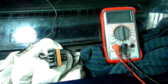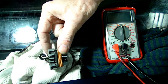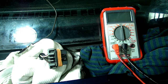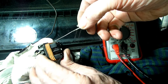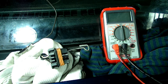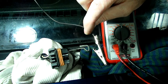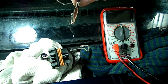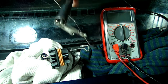After we remove the connector, the first thing we're going to do is see if we are getting voltage here. If you look closely at this yellow wire right here, that is the wire that feeds voltage up to the motor. So first thing we're going to do is set up our multimeter and get a little probe to probe the connection at the yellow wire. We're going to take the ground lead and put that to a ground — there is a good ground inside by the interior fuse panel, so I'm using that as my ground.